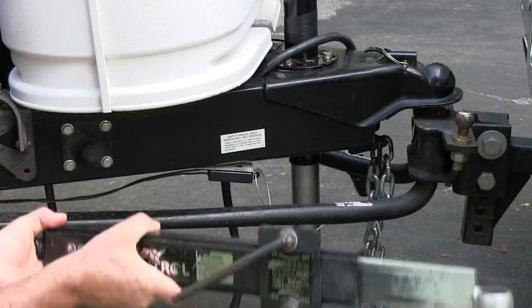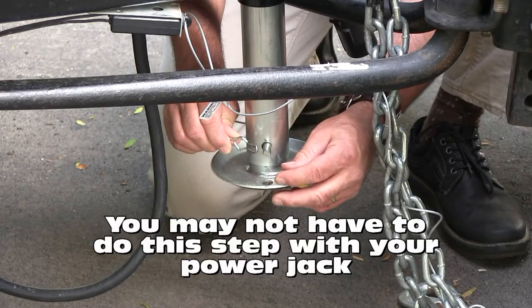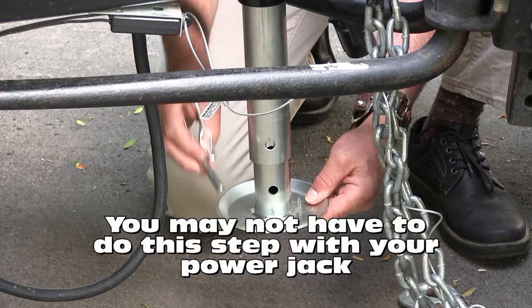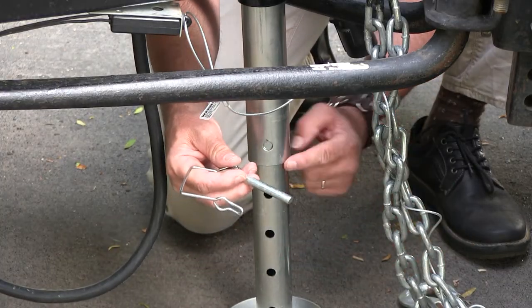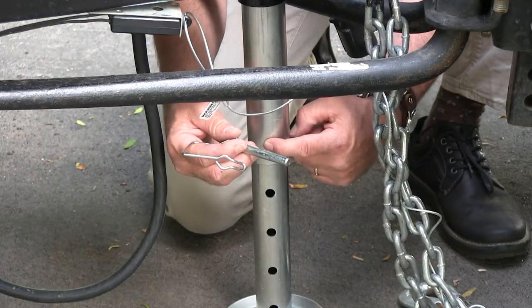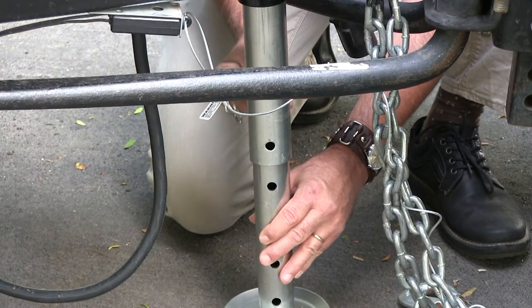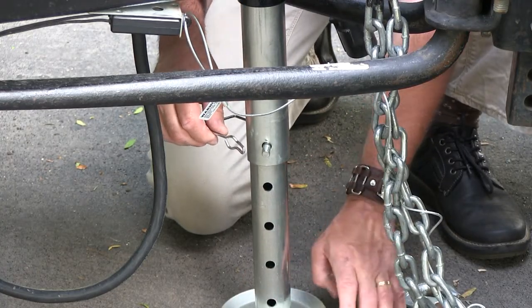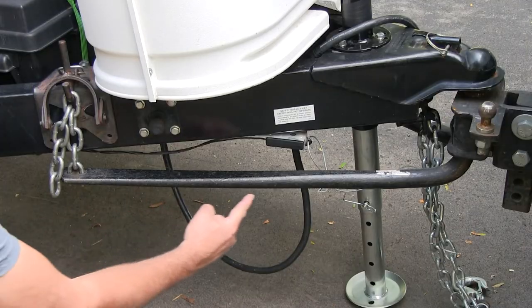This should slide off and come up here, so we'll pull this off and pull it up — and the sway bar is off. Pull this off, then pull the cotter pin out. You can see it's just a cotter pin; let it slide down. Now we need to refasten it like so — lower, close to the ground — and just refasten it.